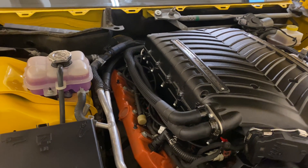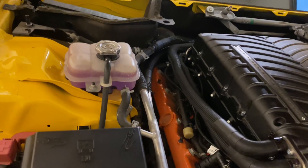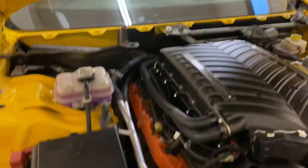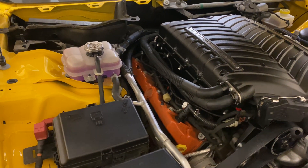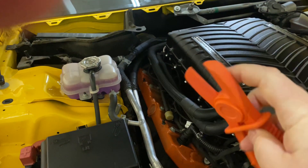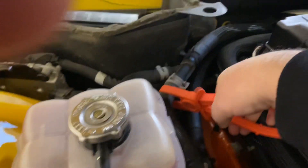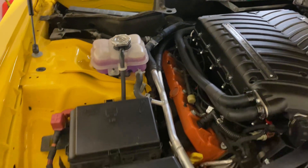It won't sound like it's sucking air and then flowing fluid and sucking air and flowing fluid. That pinch-and-release basically forces the bubbles circulating through the system over into the reservoir. You just do that for — it ended up taking us probably three minutes or so of just clamping and unclamping. We used a clamp like this, bought at an auto parts store. The idea is it's not sharp, it's really dull, and allows you to get in there. You just bite down, clamping and unclamping. And that's the way you do it.